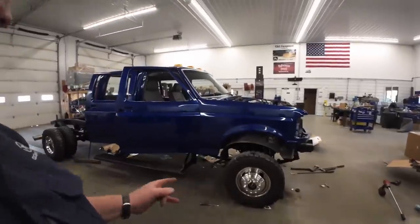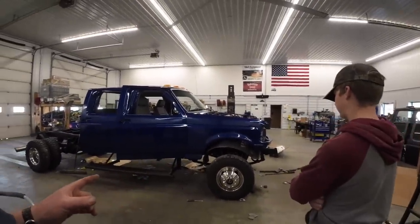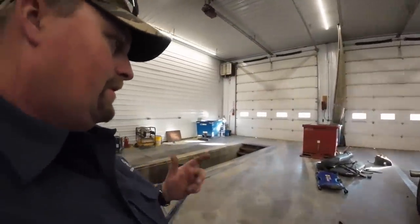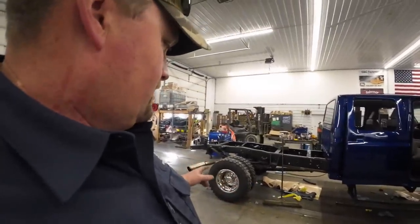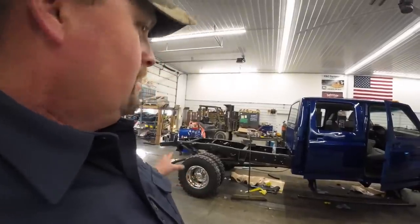So here's the deal. This is a 10 lug truck and it's kind of an oddball. They've not made aluminum wheels for these things for like 22 years. So if anybody's got a set of Alcoa aluminum wheels, hit me up. Email's down in the description below. I might be interested in them. They're 16 inch 10 lug wheels. I believe they only fit these F Super Duties. I think it's like a 7.25 bolt pattern 10 lug, but kind of oddball.